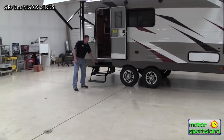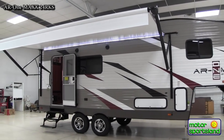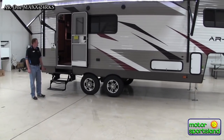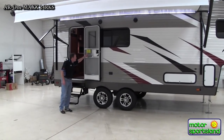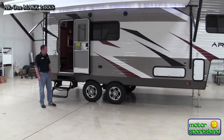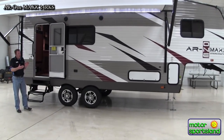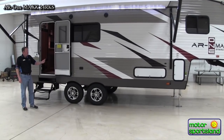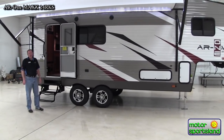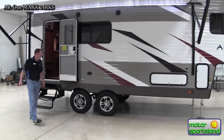You've got three steps here, not two steps. Something that's going to be real attractive with this plan is the overall length — we're talking about 26 feet. Very usable with a half ton pickup truck. Dry weight is 6,530 pounds, so that's well within the tow capacities of most newer half ton trucks. Being a fifth wheel with overlap on the front, your effective towing length is probably closer to the equivalent of a 20 or 21-foot bumper pull. Very short trailer that can go a lot of places.